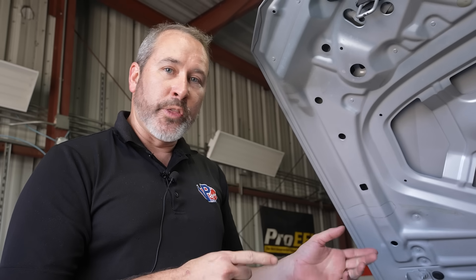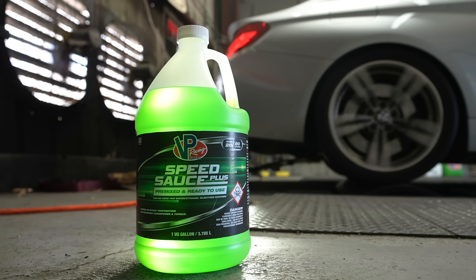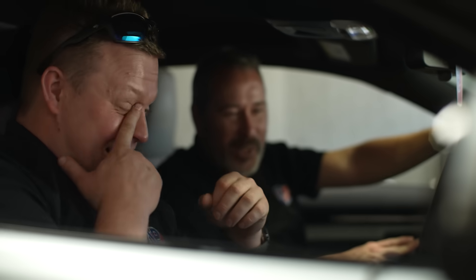In addition to that, you get the added benefit of the high-octane alcohol that's going in there, so it's an octane on demand, and that allows you to push more timing and more boost on these engines to ultimately make more power.